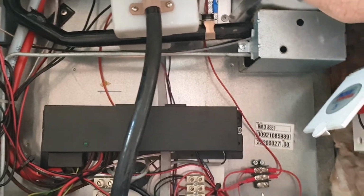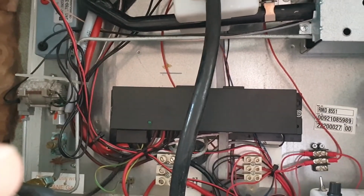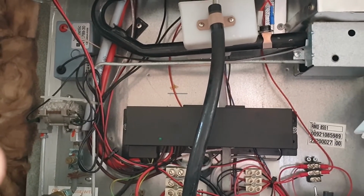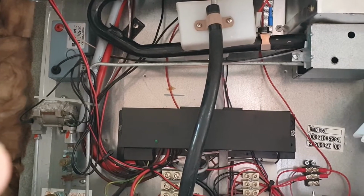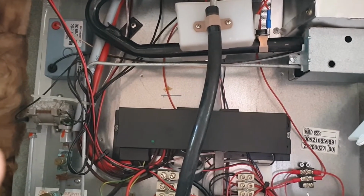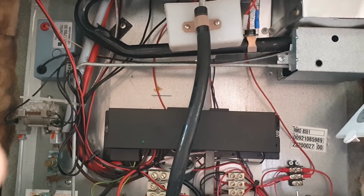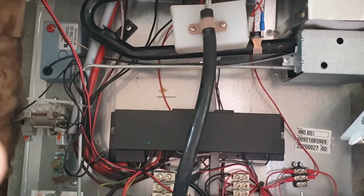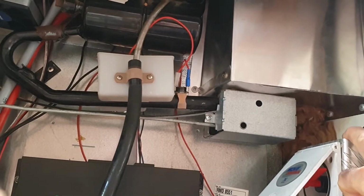So that's all of those changes there, I think, on the back of the fridge. And I'm pretty sure all these things collectively provide significant improvement, and I now think this fridge probably operates very well right up into the high 30 degrees, because I've already seen it running at 33 degrees. I started it from hot at 33 degrees, and in 4 or 5 hours, it was completely down to working temperature. And I've never seen that before. A lot of that's to do with insulating, certainly, to retaining and maintaining your fridge temperature. The insulation is important.